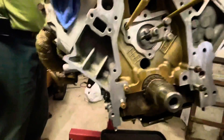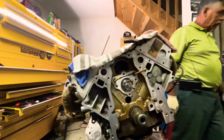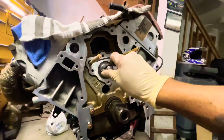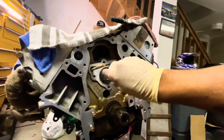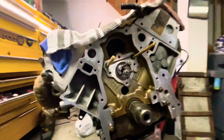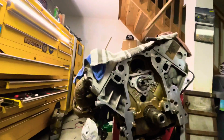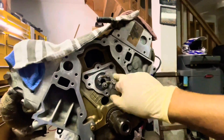Tip of the day: don't touch the rods when you have that off, because they push down these little bearings and then you can't get the cam in. But once you get it in it should be like butter — it should have a nice little drag on it. It feels so good. Now I can remove these wooden rods and that's done. Just gotta put this cover on.